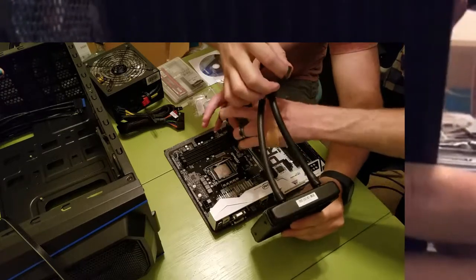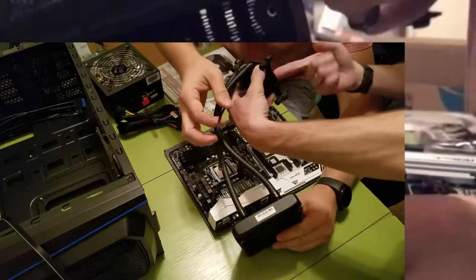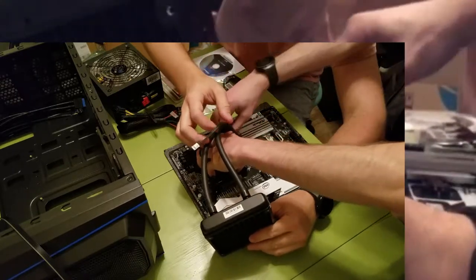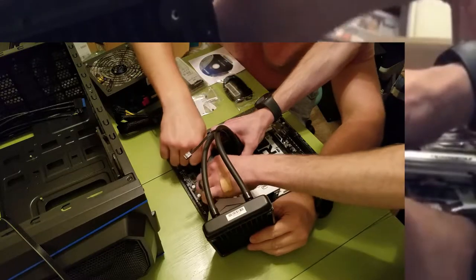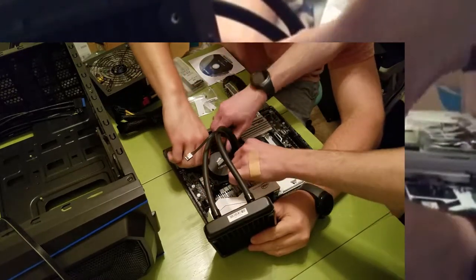And then, let's put this down on top. Yeah, that part sits straight. Now it's already got the thermal paste on, so I don't have to worry about thermal paste. But if it didn't, I would say put thermal paste on. Just not $10 thermal paste. Why not? The cheaper the better, right? Well, actually, we did a comparison test, and it didn't make any difference. It was also on an older processor.